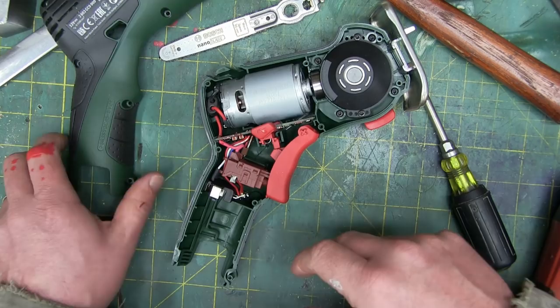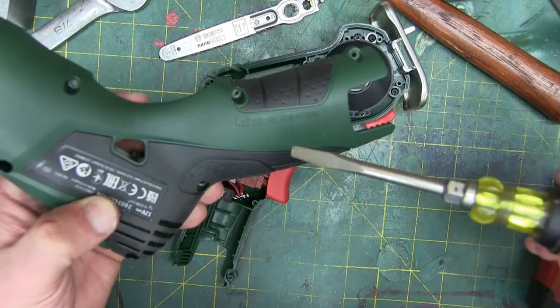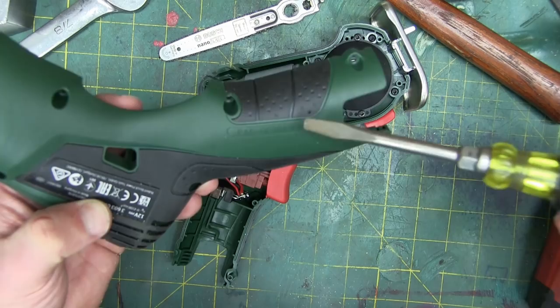They know we're looking at that sort of stuff right on the outside. So PA6, glass fiber 30% and SEBS — that's the butylene with the styrene on either end of the long chain there.